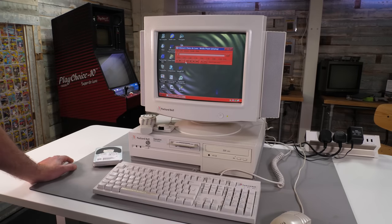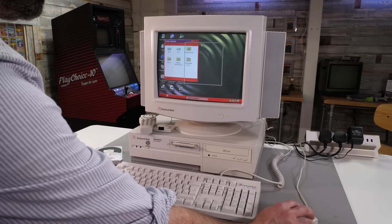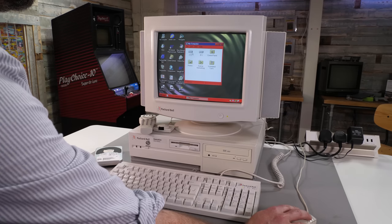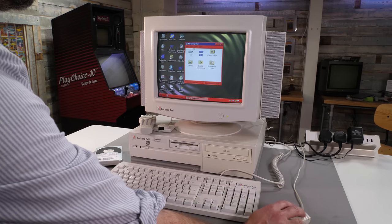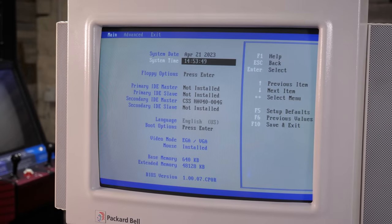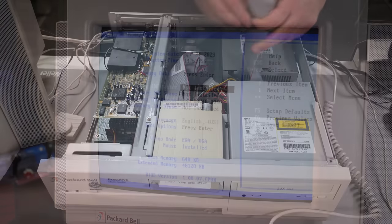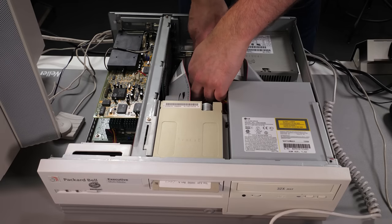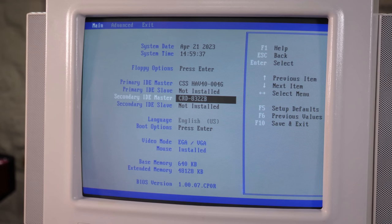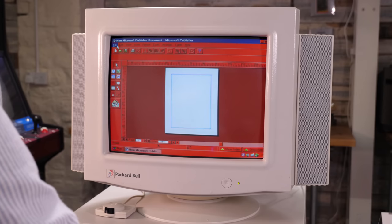Aside from the stutter on playback I found the sound card is working just fine in Windows - here's some MIDI music playing, that's Clair de Lune - and it's a mostly happy PC. Although in My Computer I found the floppy drive and CD-ROM drive were missing. I created a separate D partition on the additional hard drive space above and beyond the original disk. The missing drives were partly down to my own stupidity: in the BIOS the floppy drive was disabled and my DOM was in the secondary IDE port. I swapped them around, set the CD-ROM to master on the secondary channel and the DOM on the primary channel - they both show up in the BIOS but still not in Windows, so there are some driver or software settings to tweak. I also set the date and time in the BIOS and put a new coin cell battery on the motherboard.